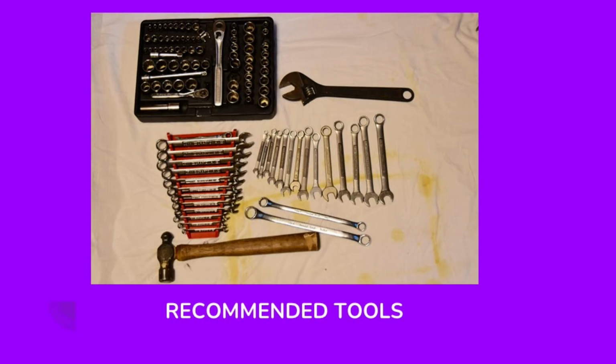If you're going to use an adjustable wrench, make sure it's a high quality adjustable wrench. Make sure that the movable jaw on the adjustable wrench does not wobble. With each turn of that wrench, make sure that you have that wrench snug on your fastener. If you're using an adjustable wrench along with other box wrenches, and you need to hold one side while you're turning, make sure you hold with the adjustable and turn with the fixed wrench. You'll be much happier with the results.